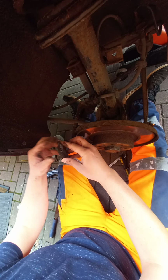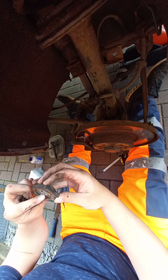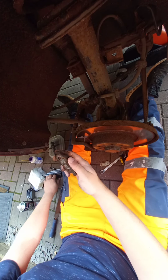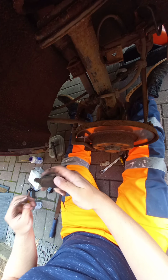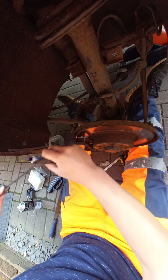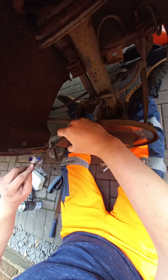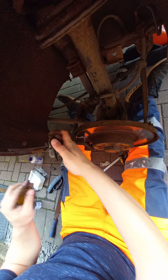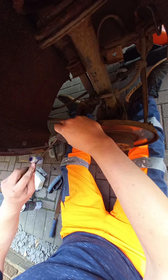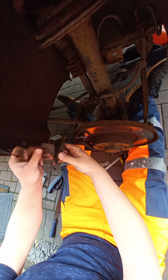Well, we've got, well, looks to be some light pads, are they? Lucas pads in an Alfa. Really? We've got some rust jacking out in here. Yep. This is why you should always keep an eye on your brakes and never let them wear all the way out, because you have problems like this, rust jacking, where the pad and the backing material drop straight to pieces. Wicked. Lose them.